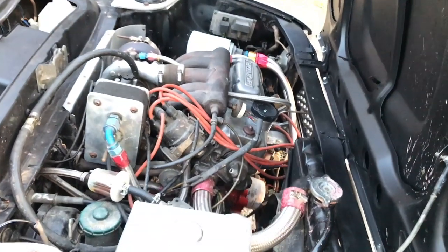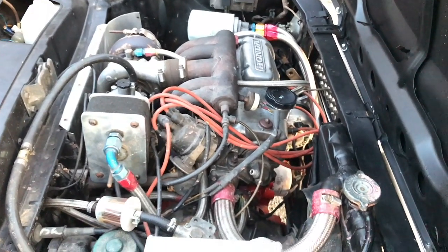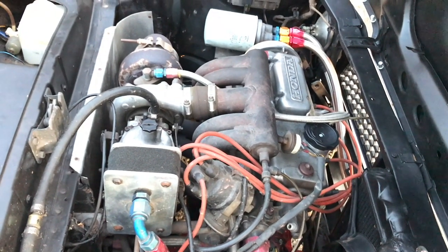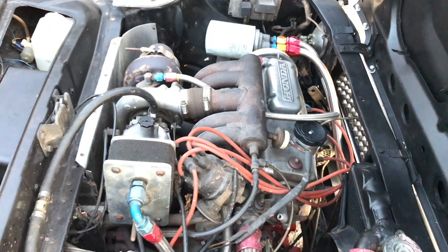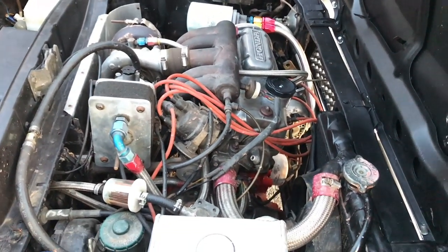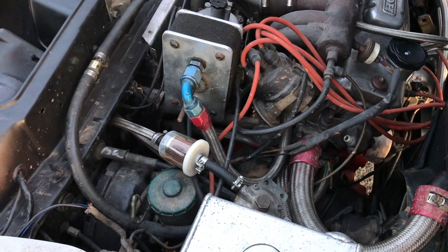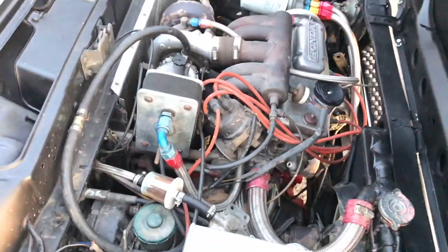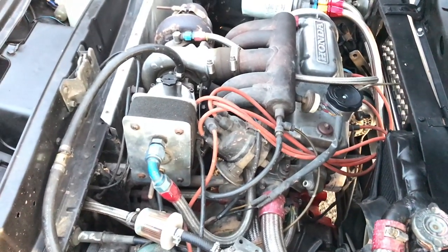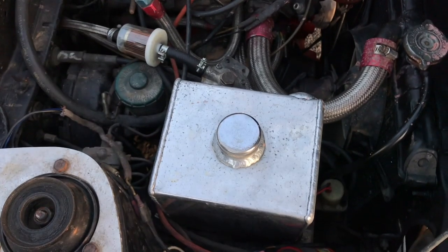The engine, like last time, was done a million years ago. It's old school — it's got the carby turbo setup. This one's running a Stromberg draw-through carby turbo. The engine was built with forged pistons. It's a 1500cc Honda overhead cam engine. It's got the water meth spray like last time. This one's water meth done by Sandy Harbutt — the guy who built the car the first time. I don't know whether he did it himself or got someone to do it, but it was done back then. So the water meth must have just been a thing they did back then — that's all they had, and that's what they did to cool them down. It works on this setup, just like the other one.